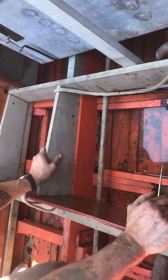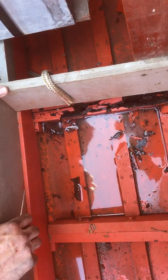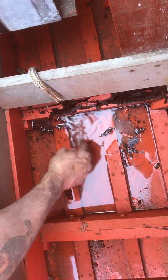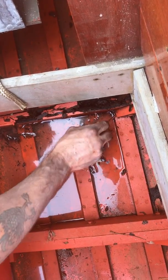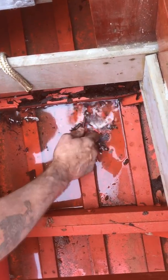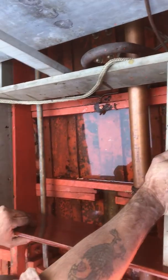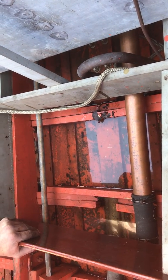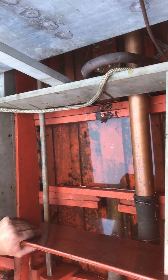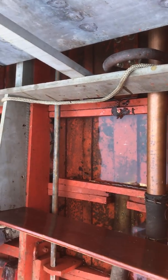The only problem is, when you have something this unbelievably damaged, what's on the back side of that we won't know until these frames come out. Could the gusset be damaged? Could the battens be damaged? That batten is damaged. Could the plank be affected or the chine? On all of these sections you run that risk and you wouldn't know until you took it out. On the bright side, the damage done up front was repaired and in the dip test it did hold — so that is the bright side.